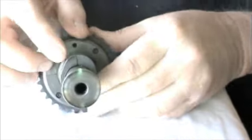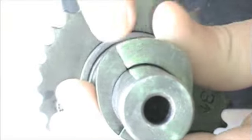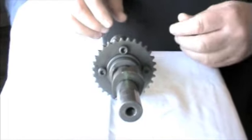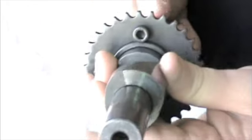Another important point is that the opening and closing flanks are always the same ones, of course. So the opening and closing rates actually don't change — they just sort of move further apart. So the flanks are always the same, and the opening and closing rate of acceleration is always the same. As you can see from here, it's just the same flanks as with the minimum duration end, even though it's a big duration. These can come right out so they're more or less just parallel across the bottom, though there's no practical use for that. But this demonstrates the duration range you can get.